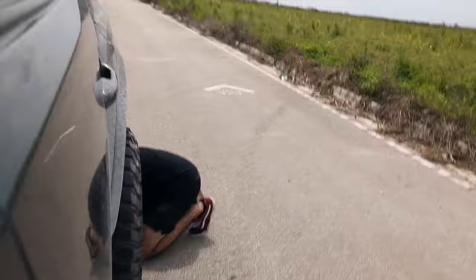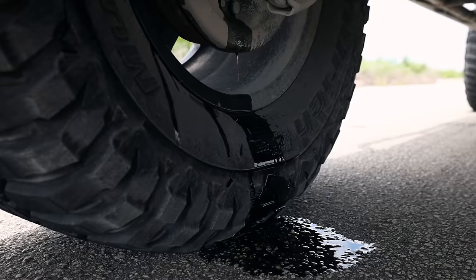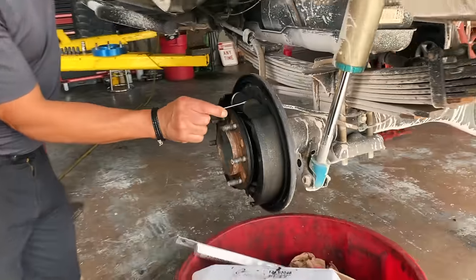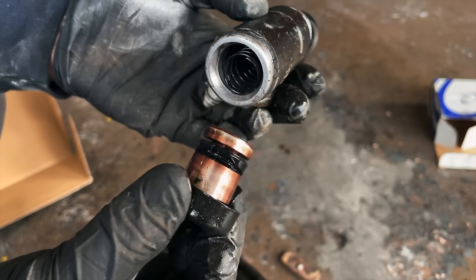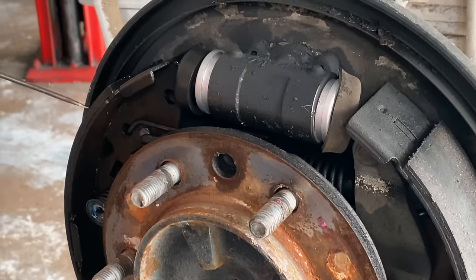We're going to have to abort tests four and five and potentially reaching brake failure — we're losing brake fluid from the back. This is not supposed to have any fluid here; this is a boot, just so dirt doesn't go inside there. You blew it out. That's where the leak started happening, coming out, and these are saturated — so yeah, these are no good.